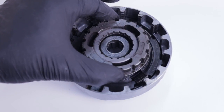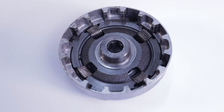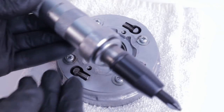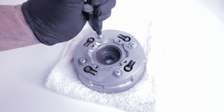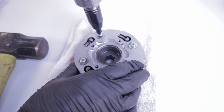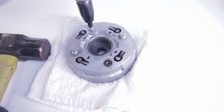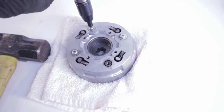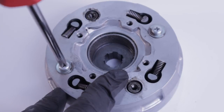Now you can remove the drive gear outer and the clutch center. Flip the unit over so you can access the clutch outer screws. These screws are usually tight and you may need an impact driver to get them out — I'll put a link in the description for the impact driver. After loosening all four screws, the easiest way is to remove two opposing screws completely, then remove the remaining two in two or three turn increments so the clutch outer does not bind with the drive plate.